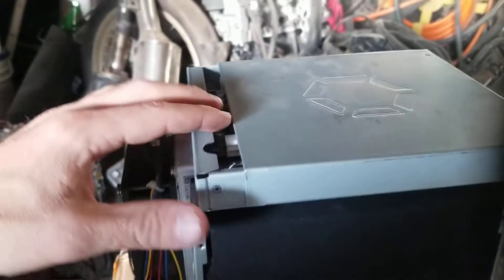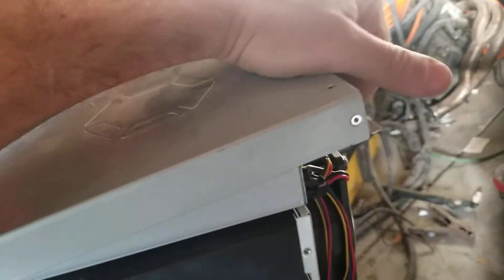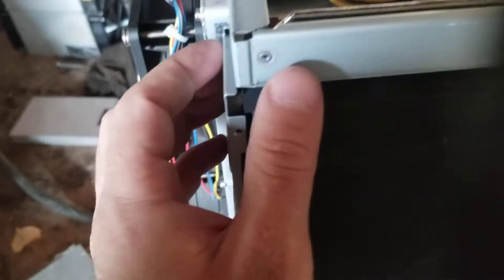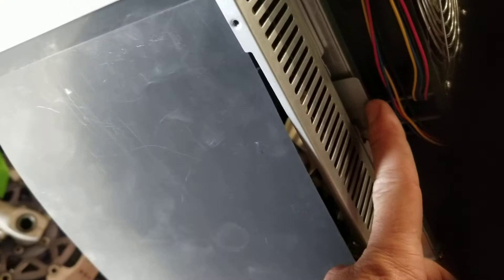Then you've got this top cover, and the top cover actually comes off very easily. You've got two screws on top of it and then it slides this way — you literally just slide it off. Sometimes it takes a little bit of wiggling, but it comes off. Then you've got four screws which we already took out, and you've got a power plug that connects here to over here. You take out those four screws, and there's one little tab on the side — you push it forward and then the whole power unit just comes right off.